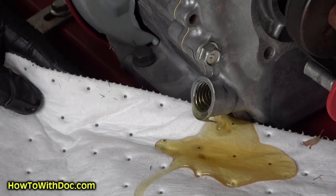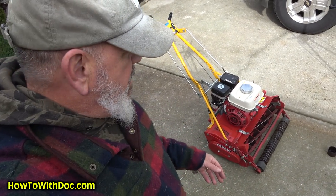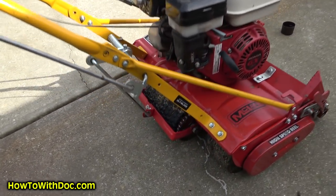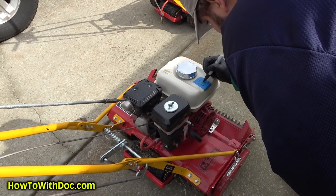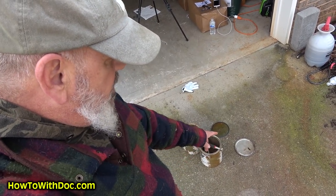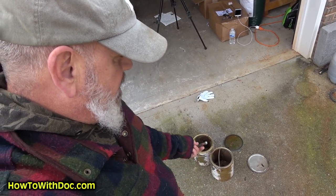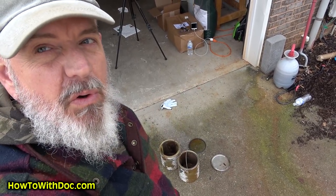Just leave it there and catch it — that's what I want to see. I want to see it filled up to the point that it starts to leak out. This one has had its oil changed. I'm going to let it run for a little bit, mainly to make sure all the seals are tight and I don't see any oil leaking. Now it's marked. Save old paint cans — what you can do is fill these paint cans up with oil, put the cover on, and write 'oil' on it. There are oil recycle centers where you can just drop that off. I may have one, two, or three of these cans sitting around for a year, and then once a year take them over to the oil recycling center.